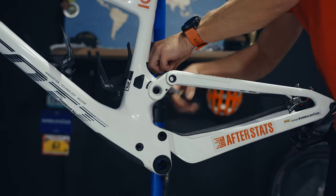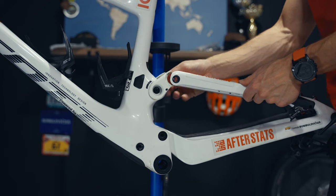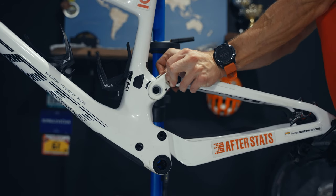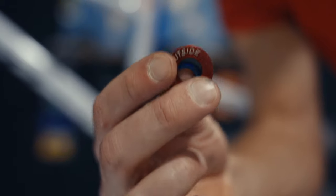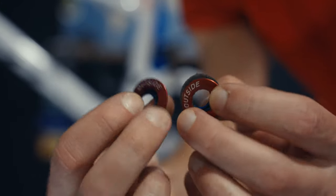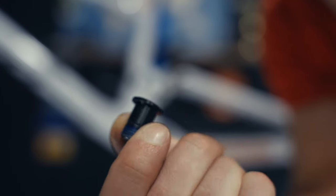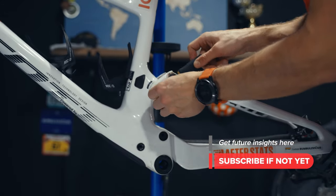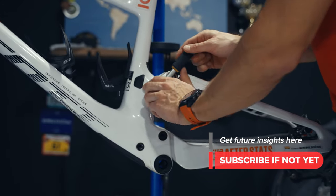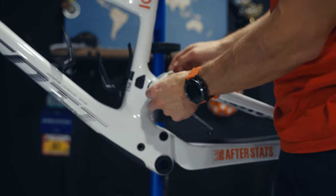The spacers on top of the swingarm are neatly labeled so you will definitely not mix things up as long as you read what's written on them — just inside and outside. If you are planning to reuse the same bolts during assembly, make sure to clean out all the thread lock, because these bolts without proper thread lock tend to loosen out and start knocking.